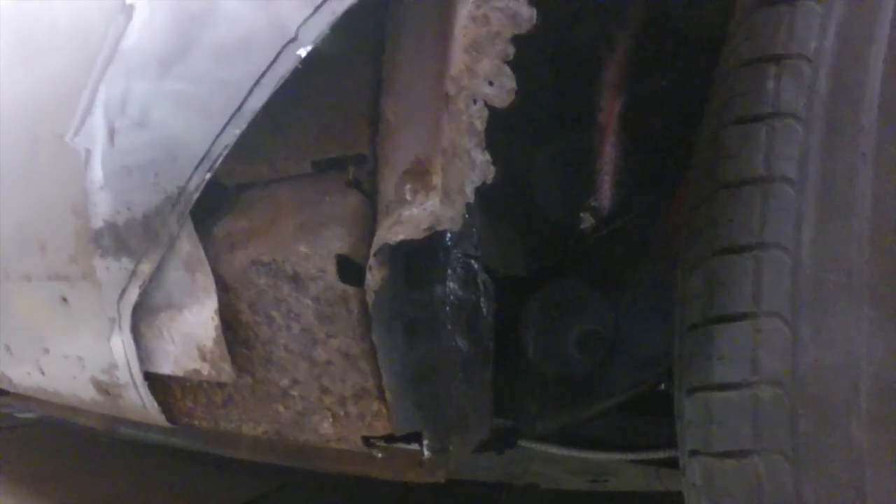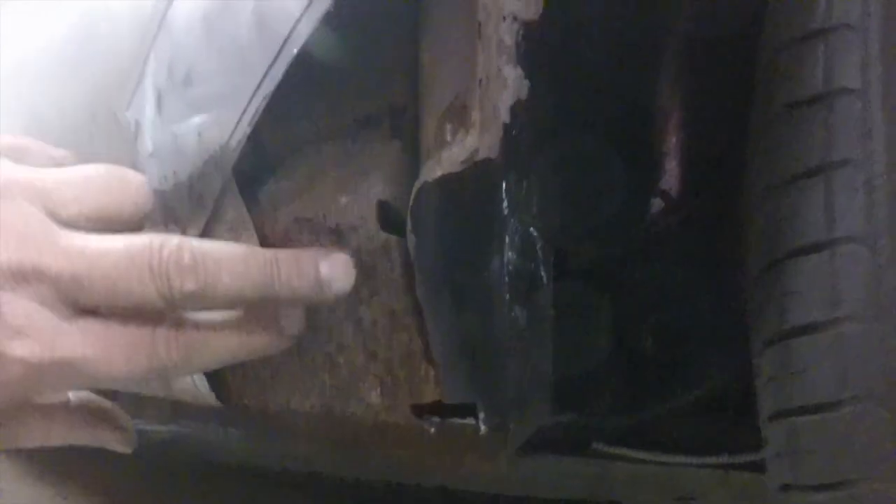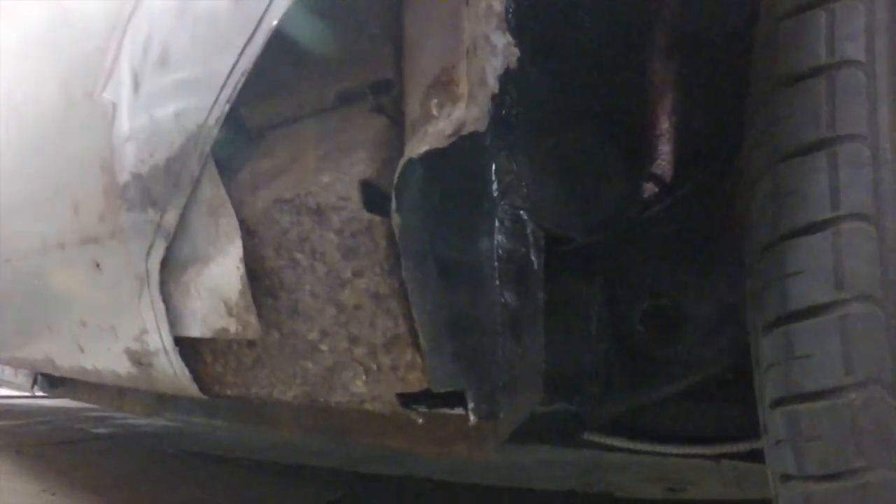Making this inner piece will be fairly easy compared to the outer piece. It doesn't have to be picture perfect on the inner — it has to look nice, but doesn't have to be exactly picture perfect. I think that's a drain there. I was hammering a spot weld with a chisel and I got to bend that back up, but I'm going to clean all that out and grind the surface rust — get as much of that cleaned up as possible.